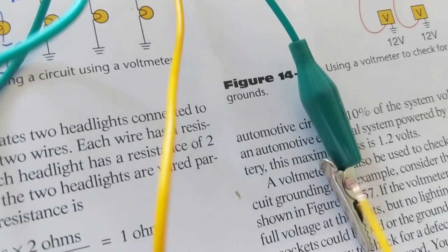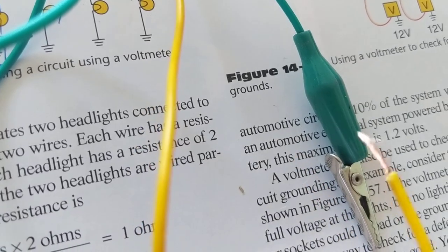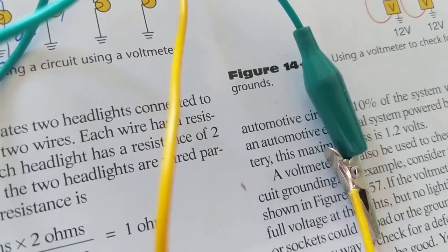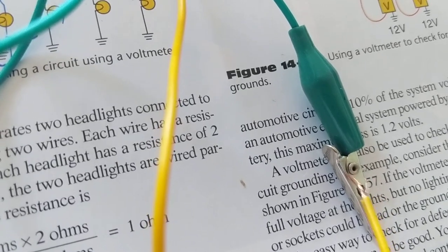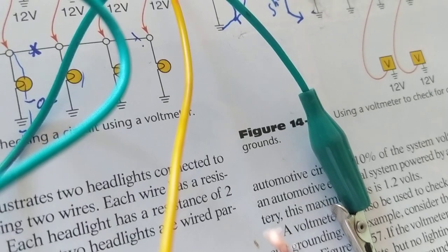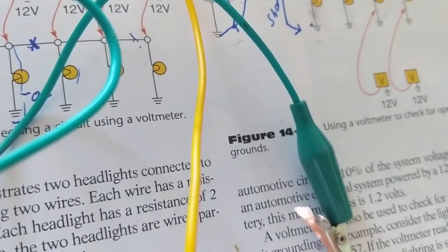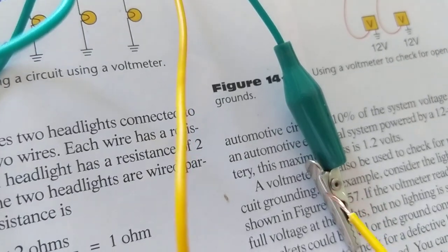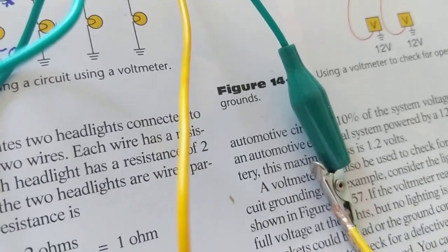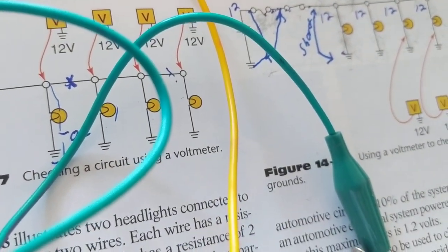Now, this is connected to a bulb. Let's say, while I'm driving, guess what? While it was dangling, I hit a bump. Boom. Now I touched the conductor part of this one to the conductor part of this one. Now I have a problem. My lights went out, or the bulbs went out. Why? Because the bare conductor, the bare wire, is making contact with another bare wire. That's a problem.